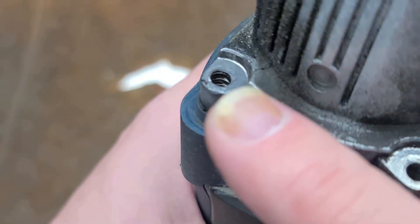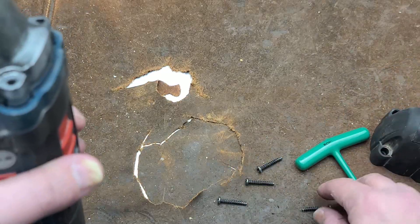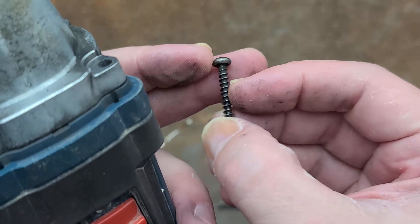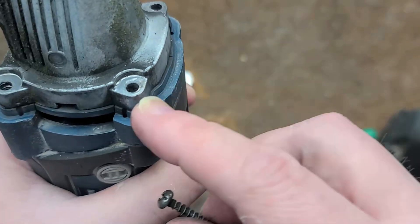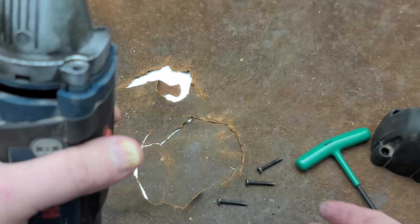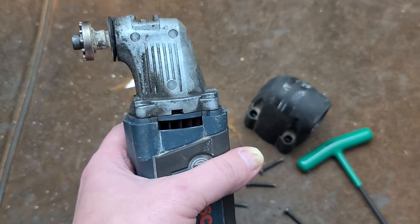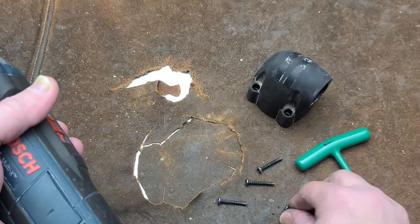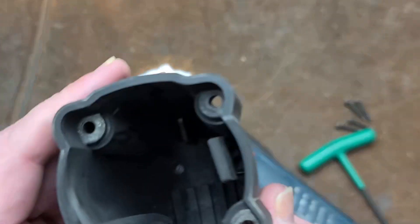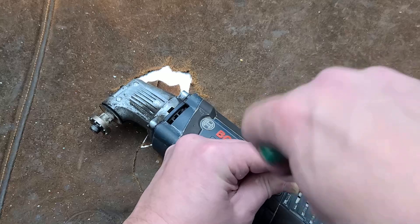That's the root cause. You can see where the bottom of the screws are silvered — the gearbox is getting loose under the plastic case and is able to move back and forth, side to side, up and down. The spindle in this aluminum power case actually has just a little bit of looseness but it's okay. Looking in the screw holes you can see where the gearbox has been racking against the threads, leaving witness marks. The best solution would have been screws with threads on the bottom and a smooth full-diameter shank sized just right for these holes so the four screws would stabilize the power case and prevent it from shifting.